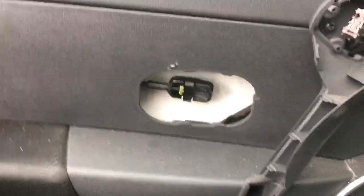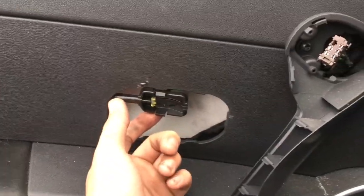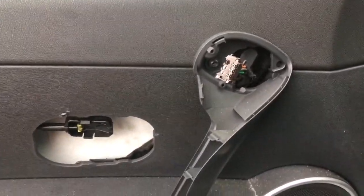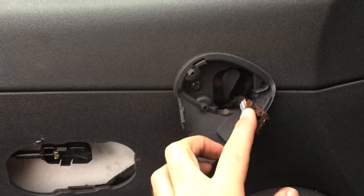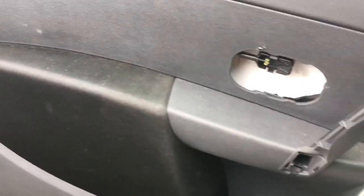Time to get the window out. Straight away I've undone the door handle, popped the release wire out, unclipped the door grab handle, and disconnected the wiring. I'm going to remove the Torx bolts — there's one there and I think there's two or three under here. The door card's nearly ready to be removed.